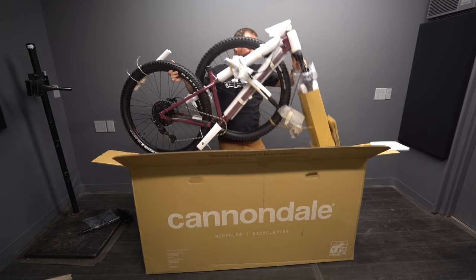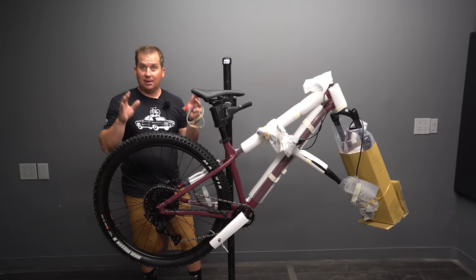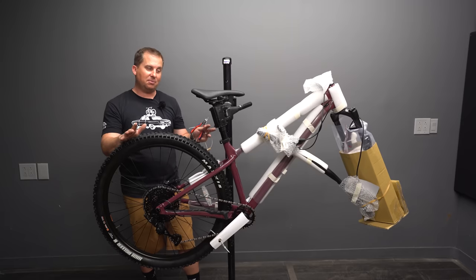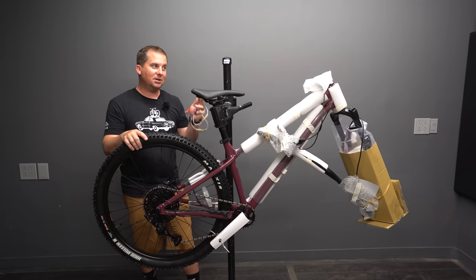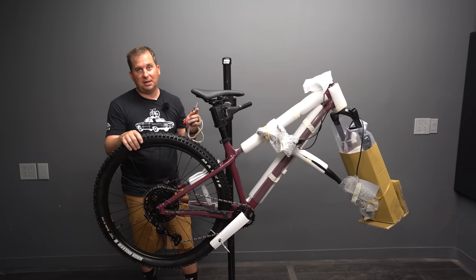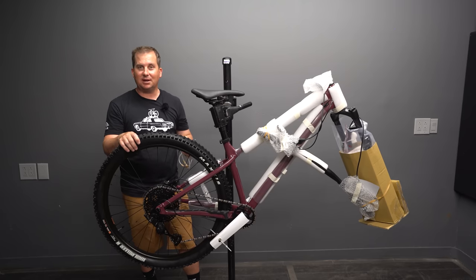So this is the Habit HT, HT for hardtail. The Habit HT3 is the same frame, $300 cheaper, same frame, same geo, just different components on this. And to have a 130 mil hardtail with great geo is amazing. This is where hardtails should be. They should be affordable to the masses and get you a great trail experience without, you know, costing $7,000.